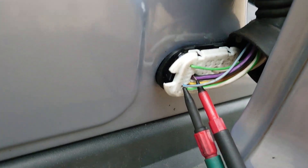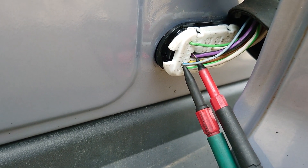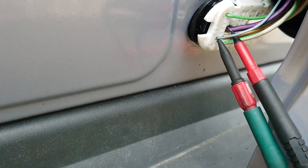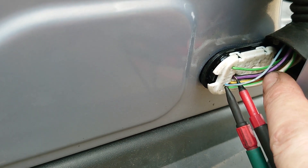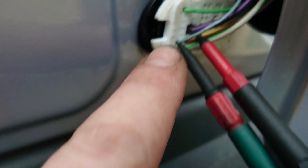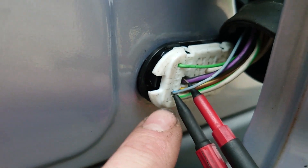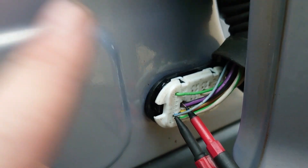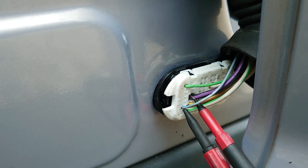So we're in the door shut here. I've just pushed back the rubber grommet boot. I didn't have a good enough wiring diagram, so I started having a poke around. It seems that the black and purple is a big earth, probably goes to the motor. I worked out that the second pin in — grey and blue on this side — is a communication signal. When I probe into here on this side, it doesn't give me that signal.